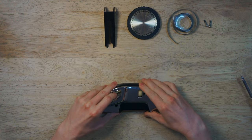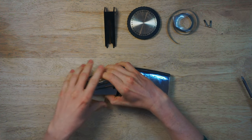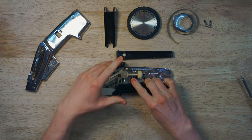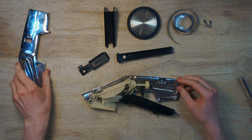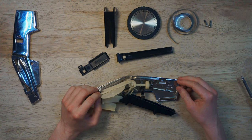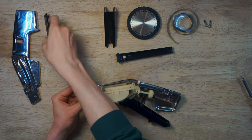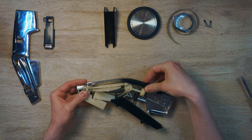Okay, now we can remove one half of the enclosure. Let's be careful here — there is a large spring in this mechanism that can pop everything out. So go easy, go slow, take your time. If some pieces fall off, that's not a problem. Let's keep our finger on that spring so it doesn't launch everything across the room, and we can decompress the spring by releasing the embossing lever. Now we can see the inside of the label maker. This is a good time to take a look at where everything fits and make sure you understand how everything goes together so you're ready for the reassembly.